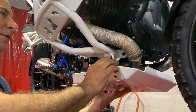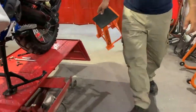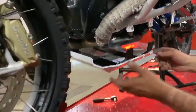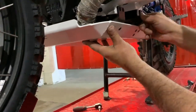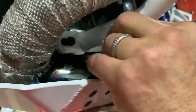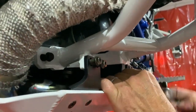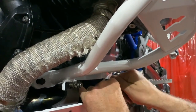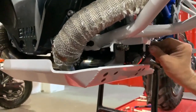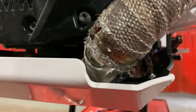While watching the video, ignore any loose bolts — that's just because we're in the middle of installation. Going around to the other side: line everything up, roll the bolts through using your fingers. If the distance between the two brackets is slightly small, you can generally just pull it over and hook it up. If yours fits a little snug, that's perfectly fine.